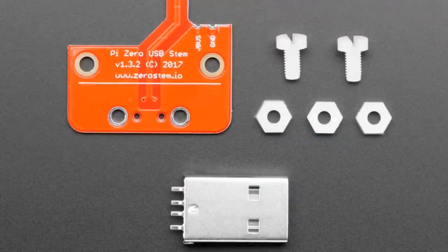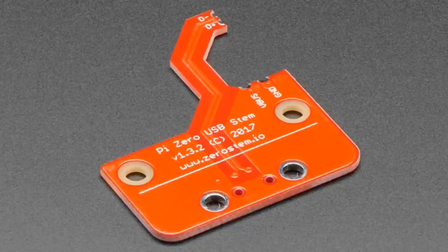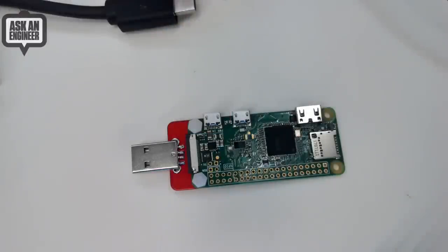It's an interesting way for you, if you have a cluster of these that you want to configure, or you want to have it act like a USB drive, or you just want to connect directly over serial through USB. We have a guide on how to use the Raspberry Pi Zero in gadget mode. It's not too hard — you just have to edit your boot config, add a line, and enable one or two things. And your Raspberry Pi Zero is a USB stick.